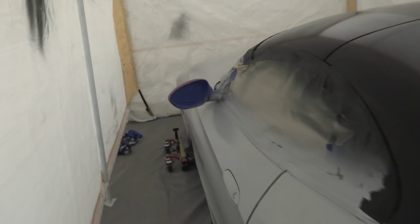B is for build and B is for busted up paint jobs. So we got a little bit of tiger striping. You can kind of catch it on camera right here, side to side. Last night, these were the parts that were super puddled up and still very wet. Tiger striping comes from a myriad of different reasons, but anyways, the way to go is to paint like this and then to come back and paint like this, which is what I did, which is why the tiger stripes are going that way. It's super annoying to me though, and it doesn't have to be there.